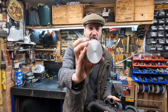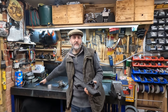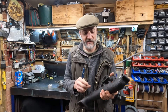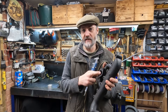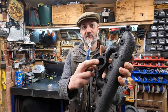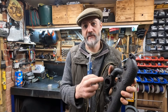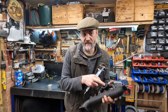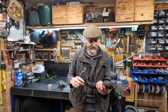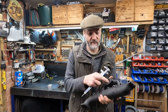Here's our block of aluminium we've got left over from another project. Now a lot of people put these spacers on and they just machine the adapter, put them on and fit the carburettor. But you also need to machine out the manifold because if you're putting an inch and eighth carburettor on you've still got effectively a three-quarter hole in there, so you're not really gaining a lot. So what I do is stick this on the mill and machine that out so it's at least an inch going in, and then it splits off to two sort of one inch parts to go into the engine. So let's get this on the mill and I'll show you what I do machining this out.